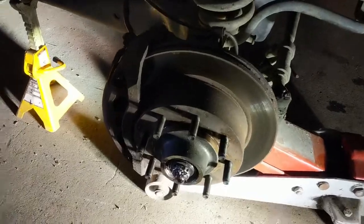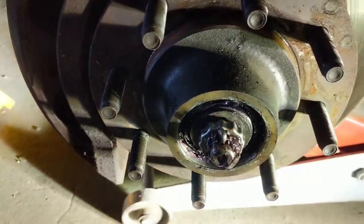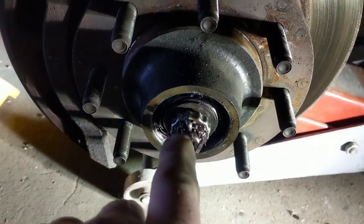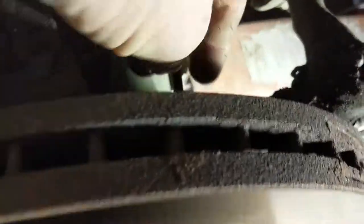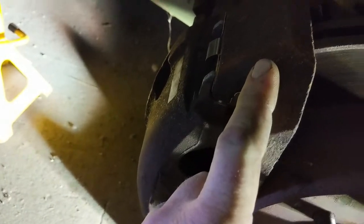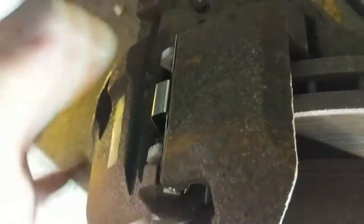Alright guys, so we got our wheel off — it was a bunch of lug nuts, 7/8 size, so we knocked that off. Conveniently when the rim dropped off it hit the grease cap right there and knocked it off, which is good because we actually have to undo this lock ring and take the rotor right off because we can't get at the sensor without that. In order to do that, first we've got to take this caliper mounting bracket off — not the caliper itself. There's the brake caliper and then there's the mounting bracket. There's one big bolt there and another one down at the bottom — that takes both the bracket and the caliper off at the same time. You don't have to mess with two separate parts.